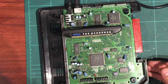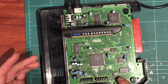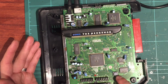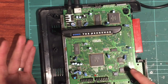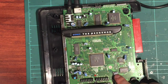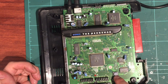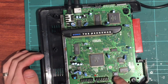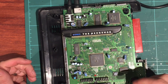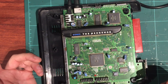I'm just putting the console back together and everything's fine, but I forgot to test the reset switch. Doing a quick test - the button wasn't working. So I'm adding this part to the video to show how I fixed that reset switch. Underneath the button it just pushes a piece of plastic down, squashing the membrane to make contact. What's probably going on is that underneath the contact it's a little bit dirty. Unfortunately, opening these up and putting it back together without damaging it is a bit difficult. It still works, but you need to push quite firmly in the very center.